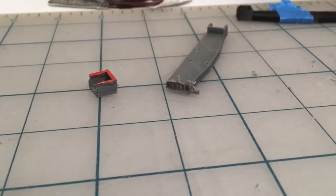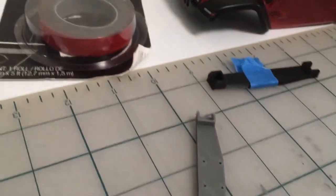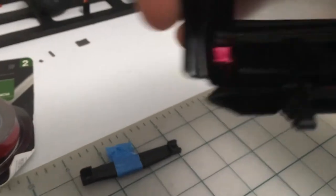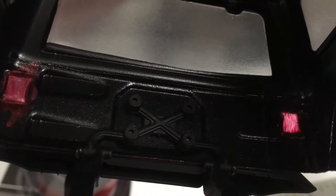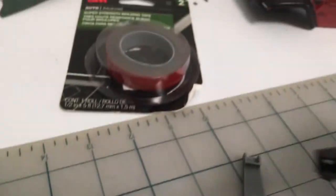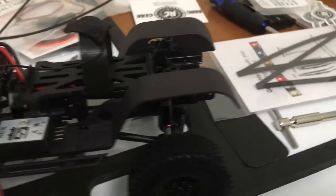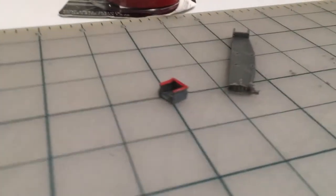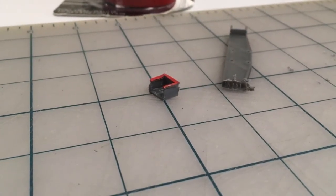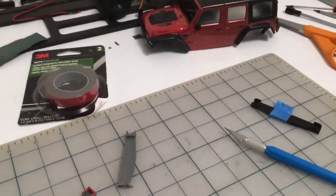As you can see here, I took a little height off of the bucket and then cut it off the arm. I'm using some 3M double sided tape to test fit that. The issue is they mount right there, and since I did a body lift I lowered that mount, so that would put this piece sitting lower than the light buckets. There's also the issue of the rear inner fenders and clearance. With the body lift I think this will work - that's why I'm trying to take a little depth out of these. So I'm going to test fit this guy, and if it works I'll cut up the black one and install them for real.